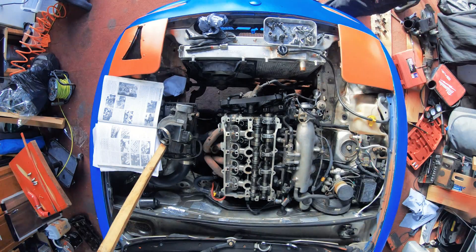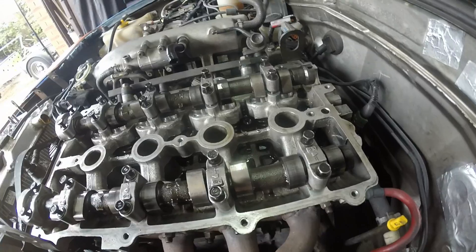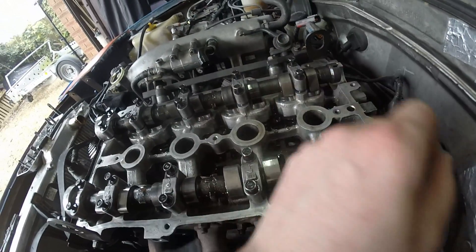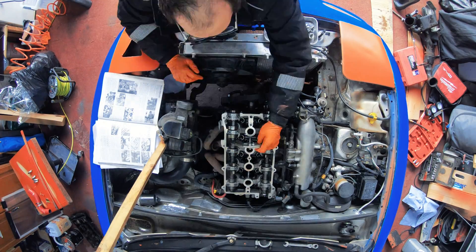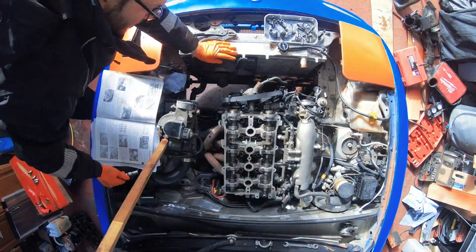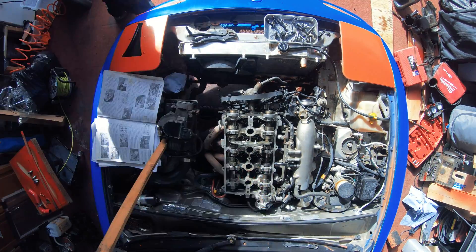I went to have a look at my old video on YouTube, and the camshaft was facing the correct way when it came off — so when it came back from being rebuilt it was facing the wrong way. I had a chat with a few people and I don't think it will cause any lasting damage since I've caught it early. I've swapped that around and I've swapped all the lifters around. Now we're going to see whether the compression issue follows the lifters, or whether it stays in cylinder number three — in which case I've got more issues to solve.